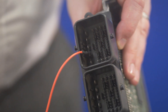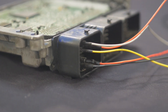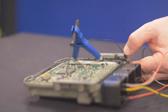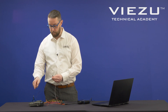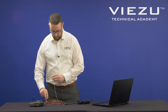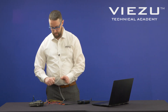So now we're going to make those connections. We take our ECU, turn it around matching it with the instructions on the screen, and make the same pin-out connections, following the colour-coded instructions for our cable colours. Once we've got our bench connections, we then need to make the pin connection to the circuit board using the individual pin and the little blue rest that comes in the kit to hold it in place. There are two options for connecting to the tool itself — we've got an extension lead that goes into our probe, and we can either use the boot crocodile clip, or alternatively plug directly into the harness that comes from the B-Flash.